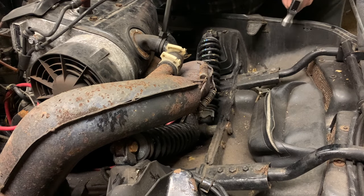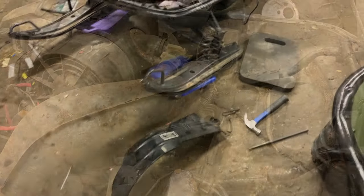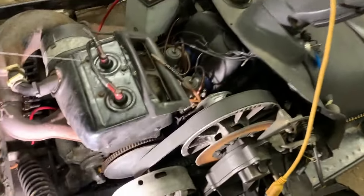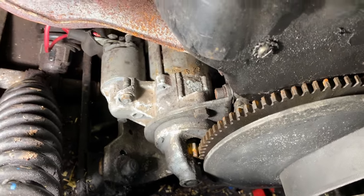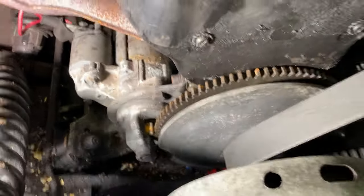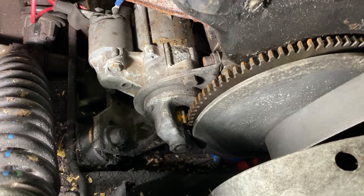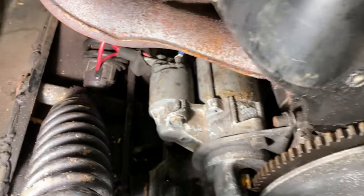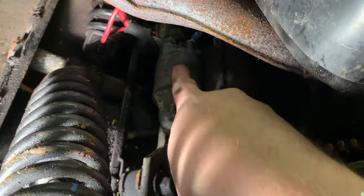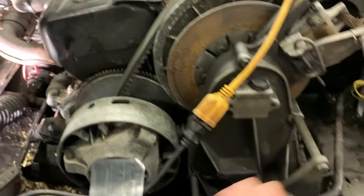I need some light, that's for sure. Okay, I just took off that cover. Effectively this is all it is — you can see the starter. I'm pretty sure she's binding. Look, there's a screwdriver down there — you never know what you're gonna find when you buy an old used sled. Somebody's been working on this. I'm gonna pull the starter off. It's probably wet or seized or maybe it needs to be rebuilt. You can see the little solenoid right here — when that gets energized it kicks out the little bendix and cranks the flywheel. Pretty cool little setup.